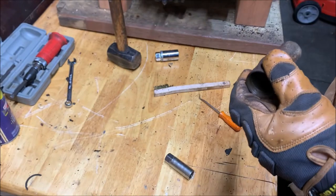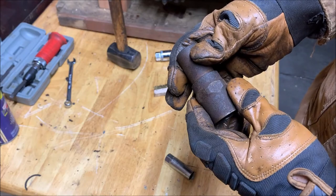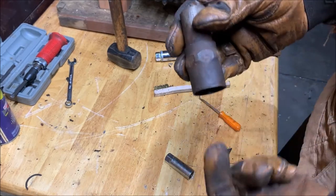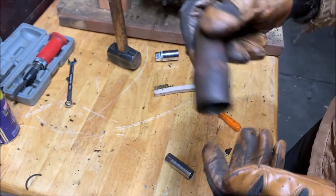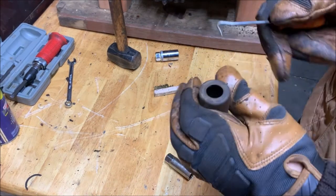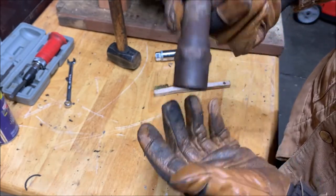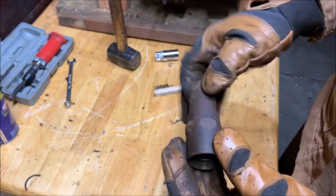And also what happens is the valve lifters on the block will actually, oil mist will permeate up into these areas, and that helps keep the oil in and not start oozing out as well. So, another piece for you guys to know about. Oh, and there was a seal, a little flat seal, looked like a little washer, that sat on this area up here, which was up against the cylinder, and the spring was holding it against it. That's just another seal. So, there you go.